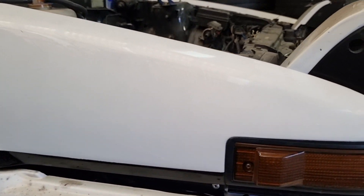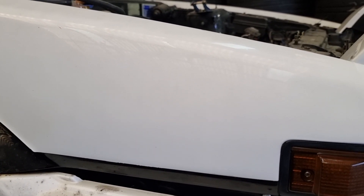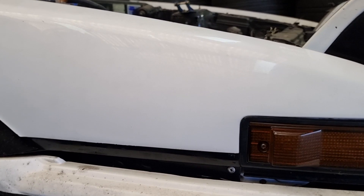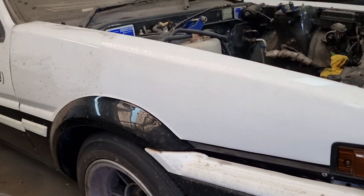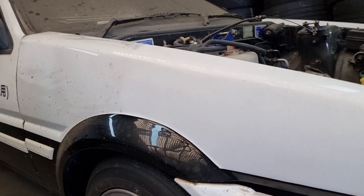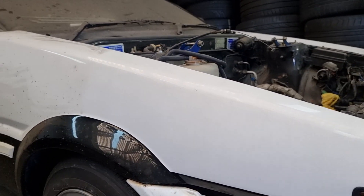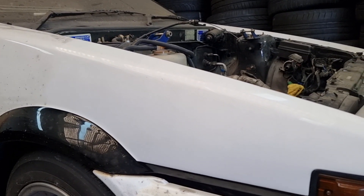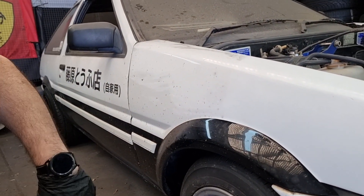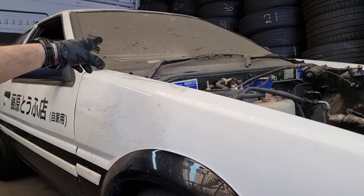I think we can safely conclude that the dry ice blasting is not damaging the paint, although I would not be using a dry ice blaster to wash a car from the outside. There is no pitting on this very old paint that I can see. This car has been sitting out here for a few years, and it's completely paint safe running this machine at maximum. Let's see what we can do to that mirror on maximum blast and then go to the glass and wrap it up.